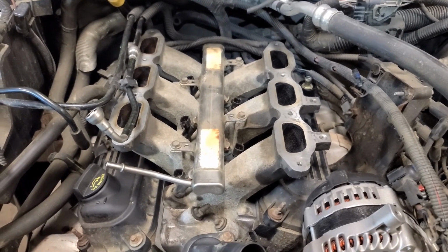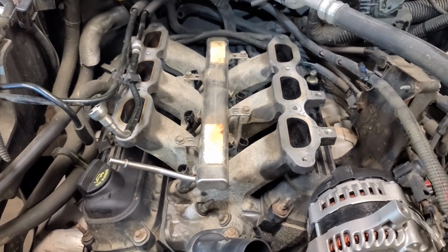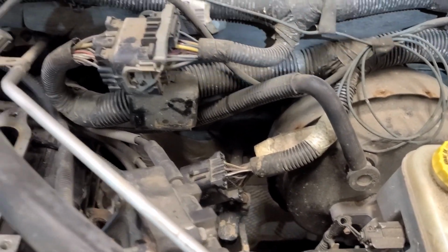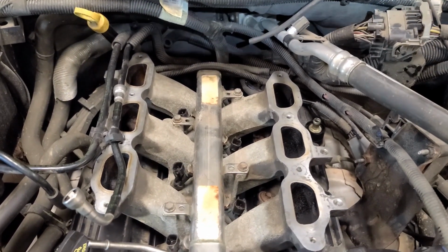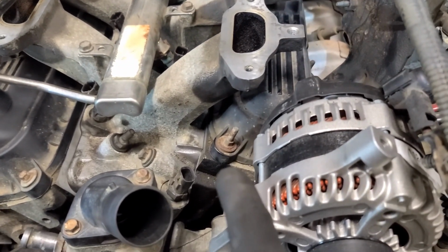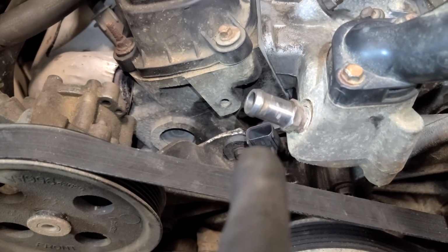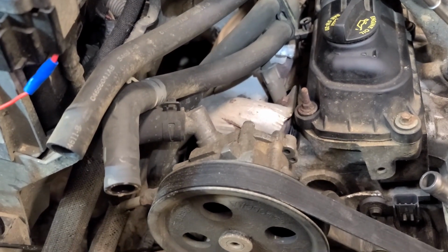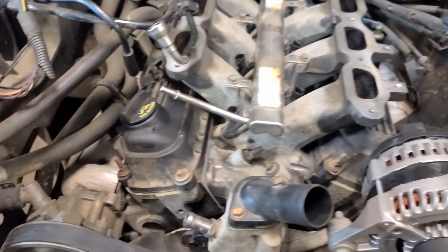Okay, everything is torqued down. Next step is to reconnect the electrical harness. That's the one, if you remember, we unplugged from over here and routed this way. What you'll be connecting for now are all of the fuel injectors, the coolant temperature sensor, the sensor that's down here that I forgot the name of, and the one that goes around here and down into the area we can get to from the fender liner. So we will connect all that stuff back up.